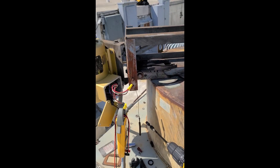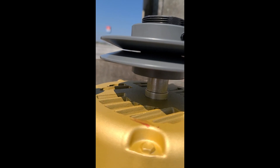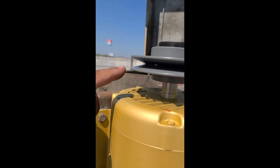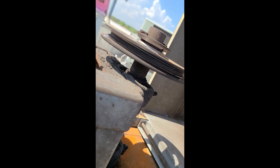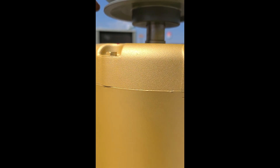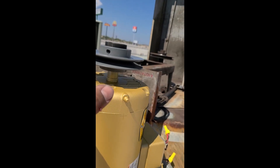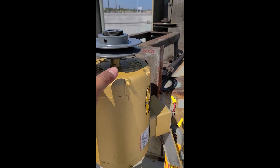Something I forgot to mention — I took a picture of the old pulley compared to the new one. You can see the new one has a nice 45-degree angle on each side. The old pulley looks more like a square profile with no curvature, nothing concave. This old pulley is pretty much bad — it's also got some bad wear and grinding. I'm not going to replace it today, but I wanted to show you so you know it also needs replacement. The 45-degree angle helps the belt stay properly seated and maintains the correct width.